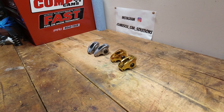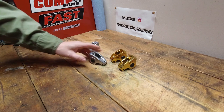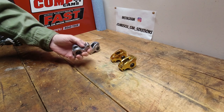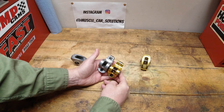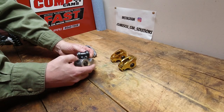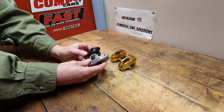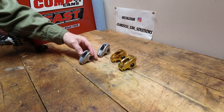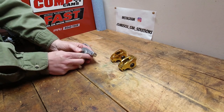On the high energy diecast aluminum rocker arm, you're at 550 on the open seat pressure and 550 on the lift — easy to remember. Max RPM on this is 6,500, very good specs for a decently powered drag car. Low cost, good strength, lightweight. If you have a low mileage street car these are probably okay, or a moderate to low power bracket car for a racing application — these are just fine. They tend to distort a little bit after a while and the trunnion gets a little bit of abuse on them, but for the time you put on at the drag strip, you'll probably never replace it.